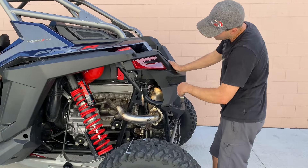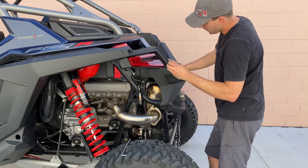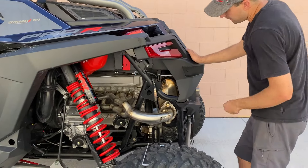We've got the 6mm allens all tightened and torqued on the manifold. Now we're moving on to the 14mm spring-loaded bolts on the muffler, and then we'll come back and hit these O2 sensors.